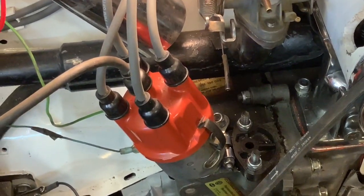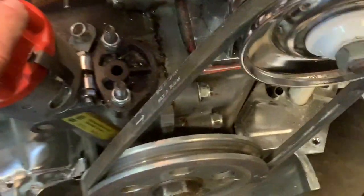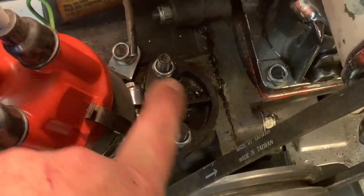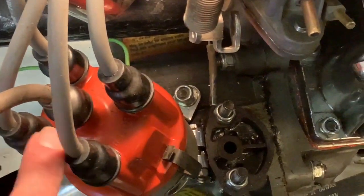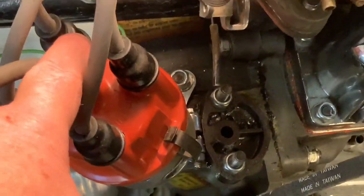It's sort of the ultimate idiot-proof design so you can always figure out what's going on. I have the distributor back together with the firing order. My number one is right up here — one, four, three, two. The coil is hooked in there. Push the clutch in.